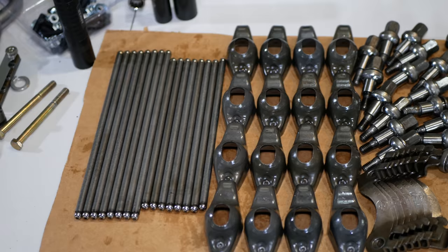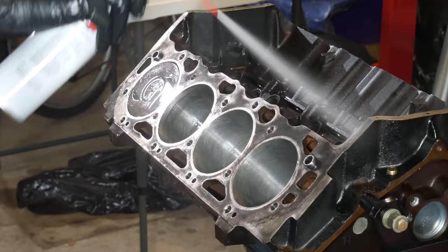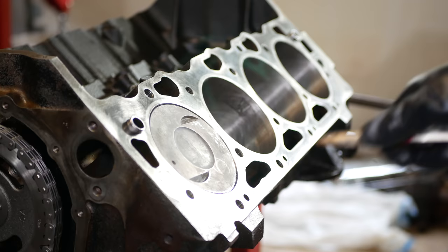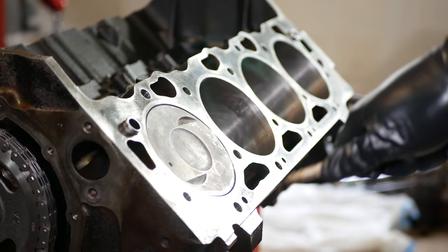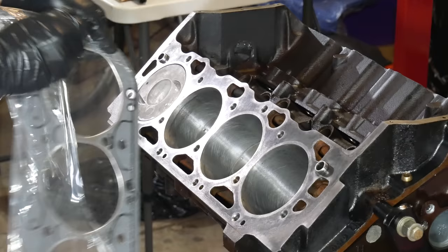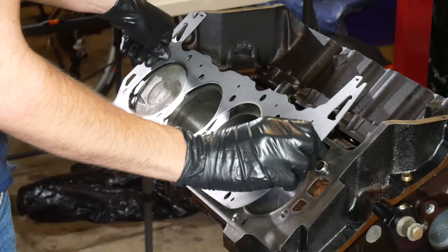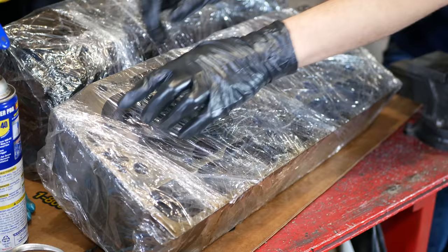With all that hardware laid out and itching to be installed, let's start by prepping the block deck surface. Starting with the driver side, we'll spray it down with brake clean and use a shop towel to wipe it down, then use the blow gun attached to the air compressor at a relatively low PSI and blow off anything left on the surface. Some of the sharp edges like to shred paper towels, so this is a good extra step to make sure there's no debris left. Then we'll go ahead and unwrap one of the new head gaskets — these are pretty standard gaskets that install with the printed seal-type embossing towards the block. The gasket fits snugly over the dowel pins, which will hold it in place while we install the cylinder head.